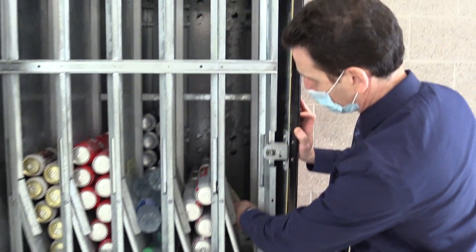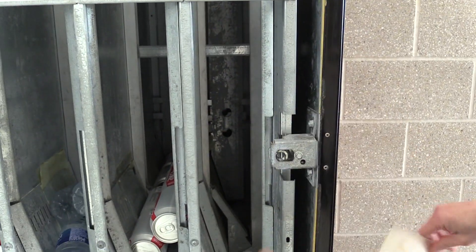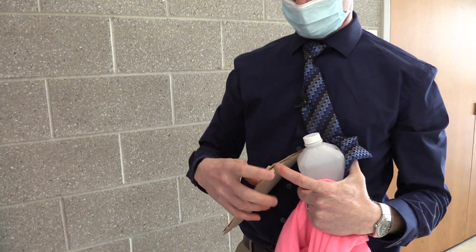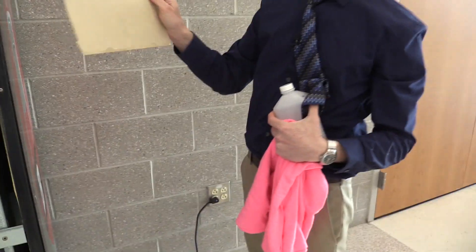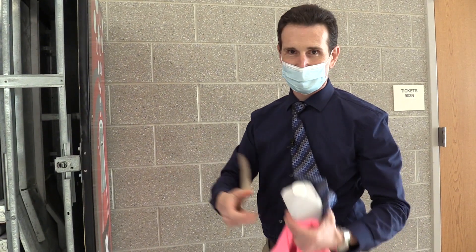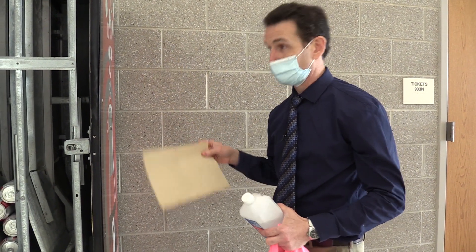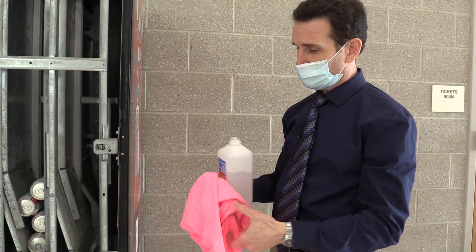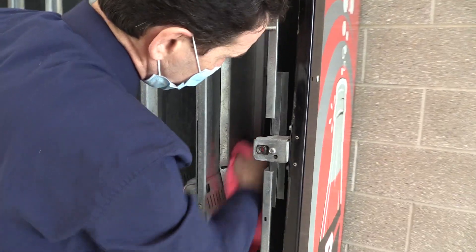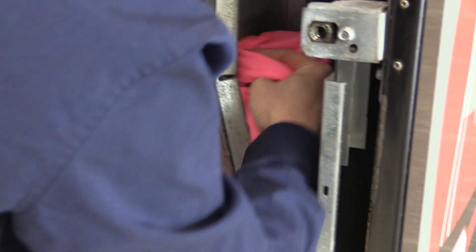To get the old ones out, just simply pull it off like so — see how nasty that looks? Before you put your new one in — the new ones are basically stickers made by 3M, a smooth plastic. You can buy them from vending companies or direct from Royal; they're about a dollar a sheet. Don't spray WD-40 in there, because people don't want their drinks coming out with some type of grease on them. Only use something that's meant to go in the vending machine. To clean it, use some rubbing alcohol on a clean rag — just pour it on there and wipe down where that sticker was, to get as much of that residue of the old sticker off before you try to stick the new one on.